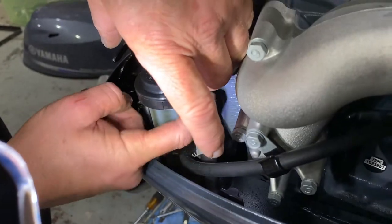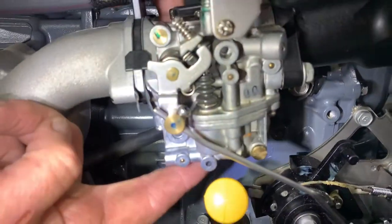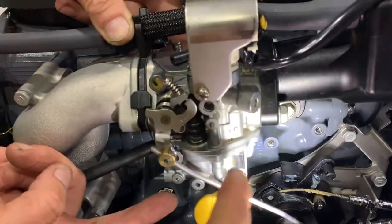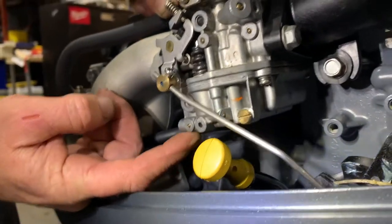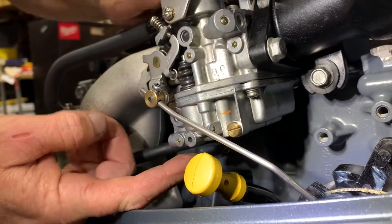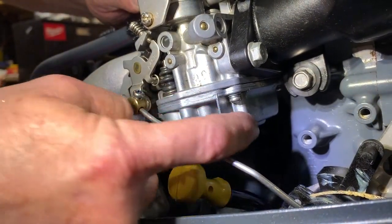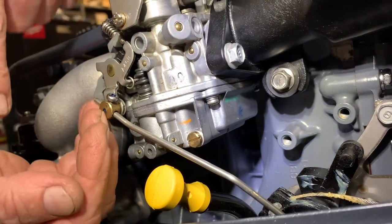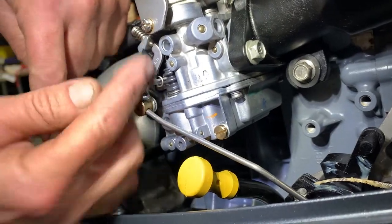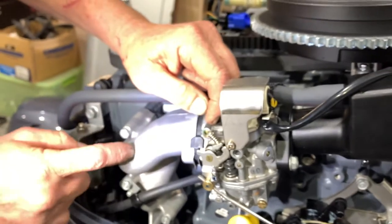It comes out of the fuel filter, and then it goes into the float bowl. Okay, so it goes up underneath. That's right. And then it goes into the float bowl, and this is our little pan right here where it fills up with fuel. And then, remember those little needles, those little holes, those jets? Yep, little jets. They're submerged inside of our little pan, which is actually our float bowl. Our pan holds the fuel, and then the jet sucks the fuel up and into the throat of the carburetor and into the intake manifold.